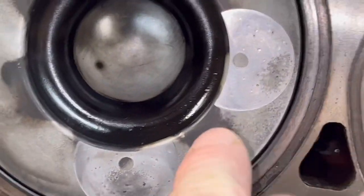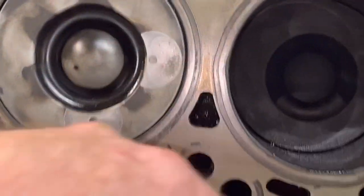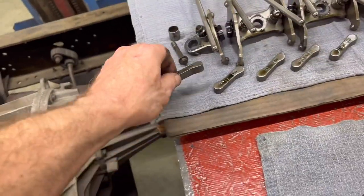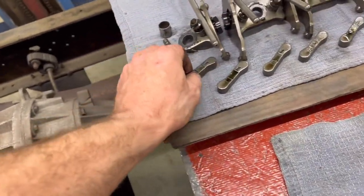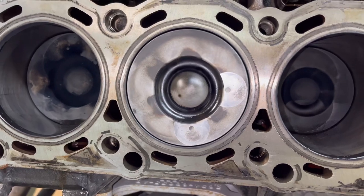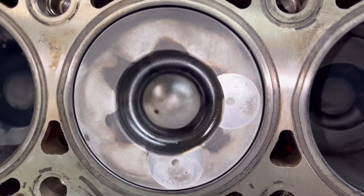Only the one because that's a valve bridge. This has a valve bridge on it. So if one spring breaks, you know the other one's gonna go right with it, because the push rod's gonna try to open one side, and the valve bridge is not gonna go level, right? It's pushing like that. So it just makes it all go haywire. It would never seal. We would never have compression with a broken spring. It's just gonna let all the exhaust combustion just go.